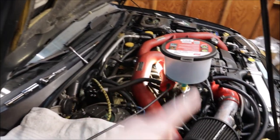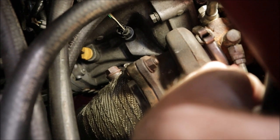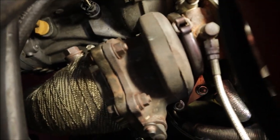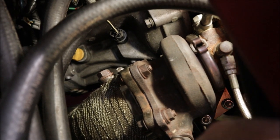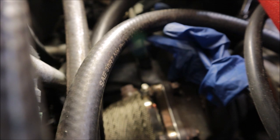Now that we have oil at the oil filter, the filter's back on. Up here at the turbo — this is the stainless steel line that oil goes through into the turbo and then returns back into the block. If oil is coming out here, we know it's going through the entire system and recirculating back into the block. I just crack that nut off and make sure oil comes out. I have the oil feed line going into this glove just so it doesn't shoot all over the car. Leave the oil filter dry — don't fill it up, because that makes it hard to pump fluid through.